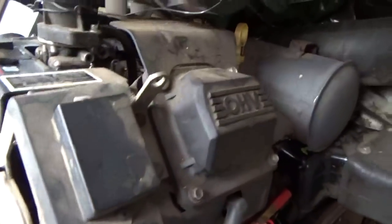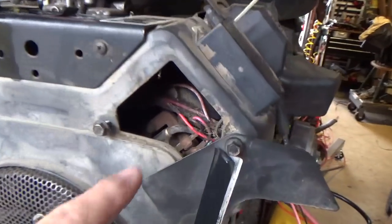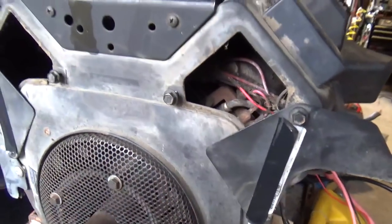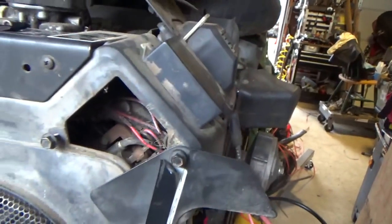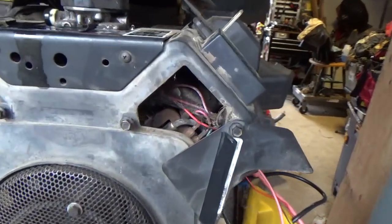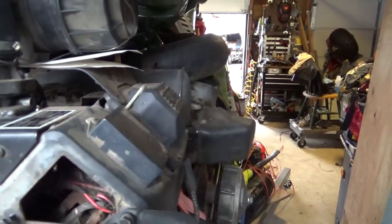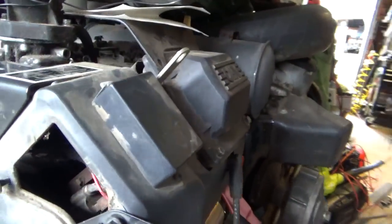There's a kind of double red wire here — that's DC power to the ignition. What Kohler did with this engine, instead of just using the two coils and leaving them timed to the position of the crank and the magnets on the flywheel, they went with electronics so they could advance the ignition when running at speed. What you get out of that is a little more power, a little better fuel efficiency — mostly more efficiency — but unfortunately it's not their best system.